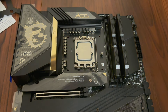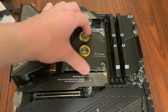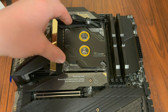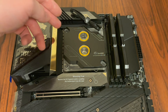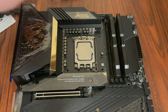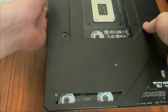To match the rest of my system, I wanted something that was just kind of going to glow around the edges, and this seems like the right choice. It's a good heavy block with really nice build quality — the acrylic piece is nicely milled out and feels really smooth, and the metal parts are substantial. Taking a quick look on the motherboard to see how things are going to go, it sits right on the CPU without touching any other components, which is good. On my other computer a while back, a cooler plate came too close to the capacitors, rested on top of them, caused really poor thermal conduction, and I almost overheated it. So I just want to make sure that's not going to happen.